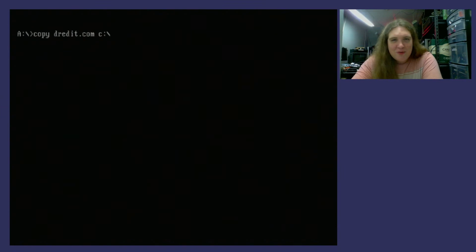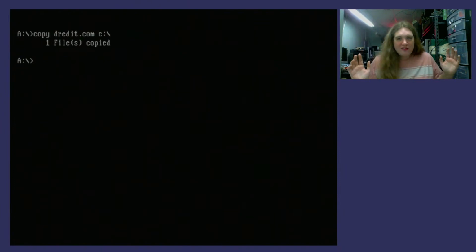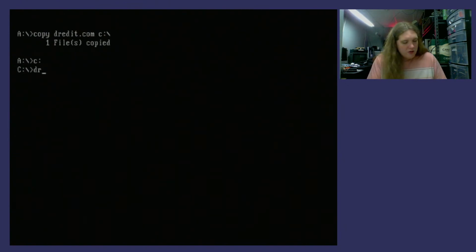Oh, yeah, so the edges are getting cut off in the video capture. Sorry about that. That's because the scan converter, there's normally so much overscan, or underscan rather, that I've cropped it to fit the nice video modes that don't make the monitor do weird gymnastics. This program is not quite as well behaved graphically. The MS-DOS shell is the same way. When you go into some of the graphics modes, it makes a multi-scan monitor do some gymnastics, and the picture gets shifted off the edge of the screen. So this edit program is in a weird video mode.